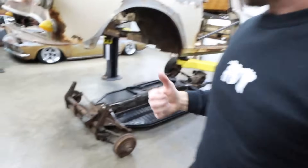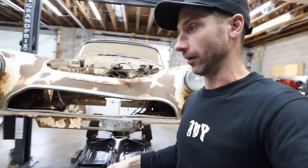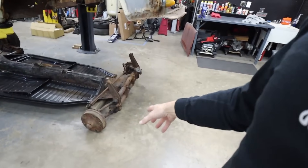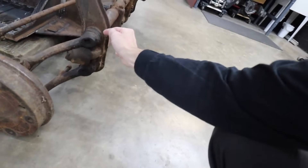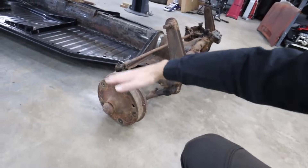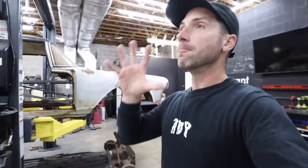I only have two wide-five wheels with the right size tire — the other two have giant balloon tires, way larger than the 17-inch diameter I'll ultimately use. So I'm going to go to the laser machine, design in CAD a wide-five bolt pattern, cut a giant center bore for the hub, and make a laser-cut plywood wheel simulator. That'll give us an overall idea of how far up the tires go front and back. But first I need to get the leaf stacks out of the front beam — top and bottom — and throw the control arms back in for free range of motion.